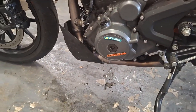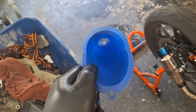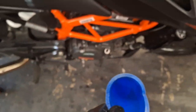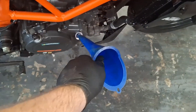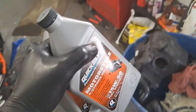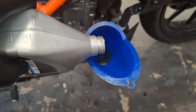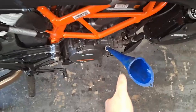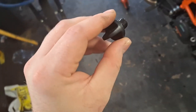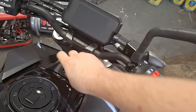I do have the lower two panels buttoned back up. That was the most difficult part of the job. If any of you work at a KTM dealership, respect — I wouldn't want to do that all day. Always inspect for debris in your funnel. I don't have any debris, so it's prepped for insertion. I'm going to install 1.8 quarts of 15W50 motorcycle oil — Quicksilver, not a sponsor. All the oil's been added; put the cap back on hand tight.